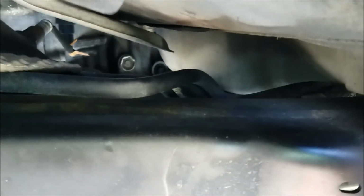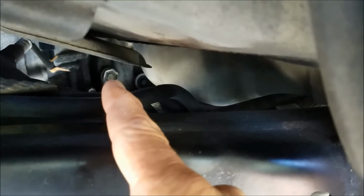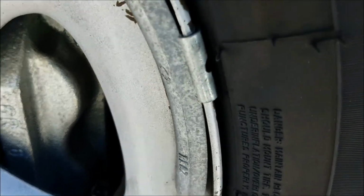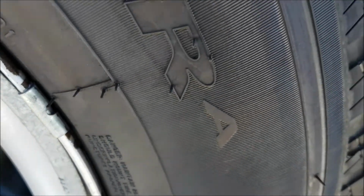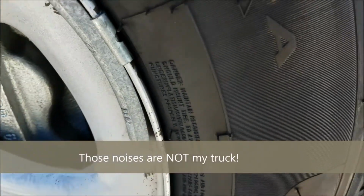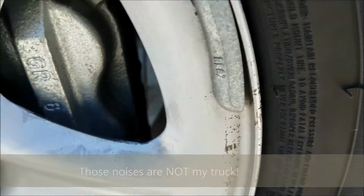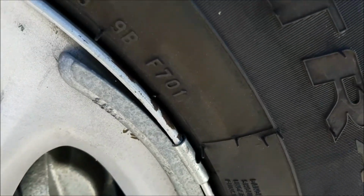Do you see that plug right there? That's the one. You can get it through the wheel well, or you can try to snake a hose down from the engine compartment, in which case you have to avoid exhaust pipes, which can really mess up a PVC hose, especially after having warmed up a little bit just now. So I'm going to do it the same way I did before, which was through the wheel well.